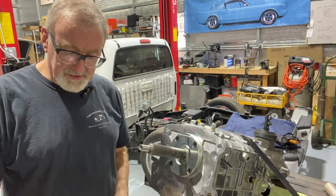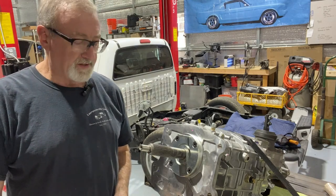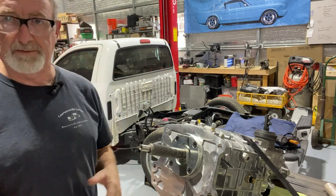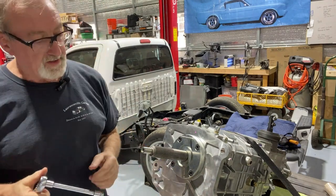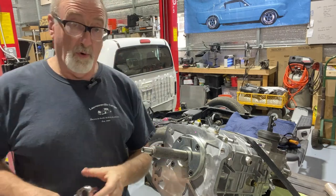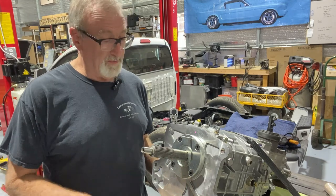In the directions it said to use 12 to 16 foot-pounds of torque, tightening these bolts in an X pattern. I have the torque range set at 14 pounds — I just picked a number in between the 12 and 16. If you're working with an older or used transmission, I can see where it would be more of a concern about those bearings falling in there, although you do want to be careful.